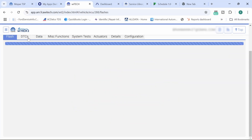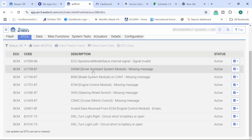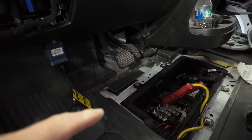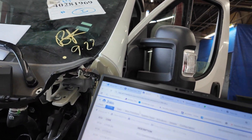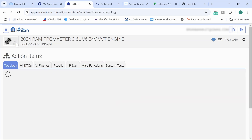I started paying attention back to the codes. In the body control module we have operational mode status internal signal invalid — very confusing. My big concern was that I couldn't turn the key off — the only way to key it off was to disconnect the battery. I also chased the security light on the dash. Looking at the RFH hub, we don't have any invalid serial or invalid key data codes, so it didn't appear to be a theft/key issue.